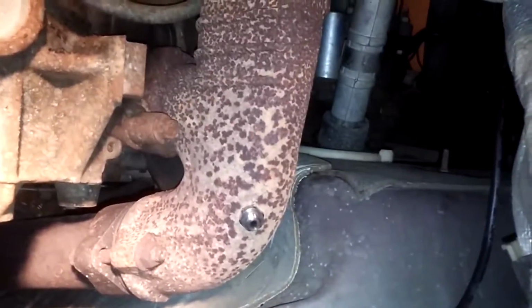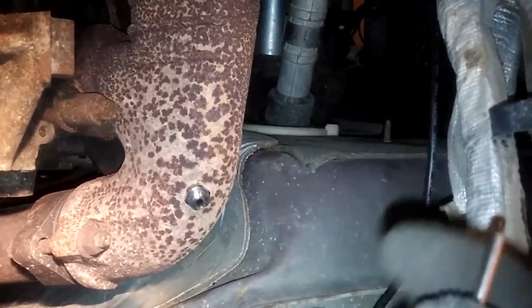And then again, another thing that wasn't mentioned in the instructions anywhere, and I couldn't find it, is how far they want the probe in. Obviously, I don't want to go to the other side, because then it'd be just reading the surface temperature. But I don't want to be so shallow that it's not doing anything at all. So what I did is I just roughly measured up the diameter of the tube exhaust manifold, and then I just cut it in half, and then put this little brass compression fitting at where I think half is. And then just twist the nut down to tighten it.